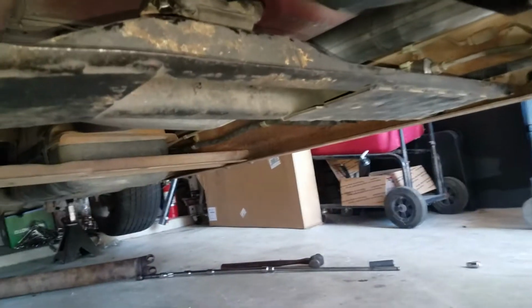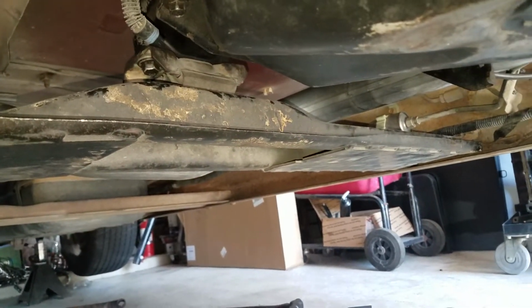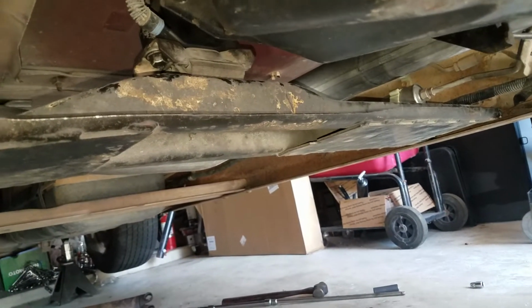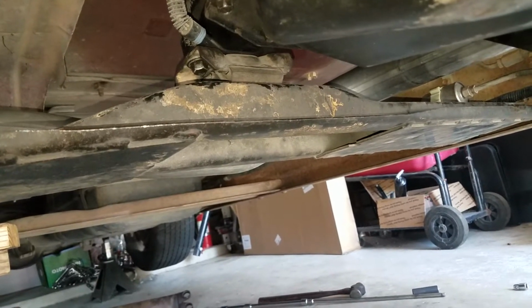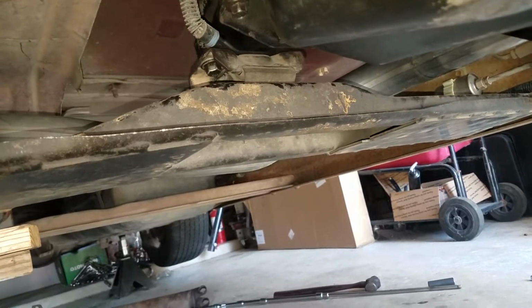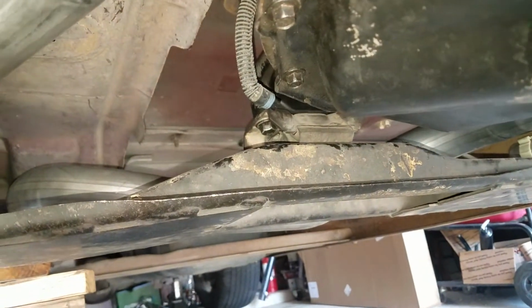And definitely, man, just don't even waste your money on the 4L60, because that 5.3 was gonna destroy that 4L60. It's good if you just drive it, you get the motor installed, and then when your transmission goes out, you swap it. But having to rebuild the 4L60 over and over again is just not really worth it.